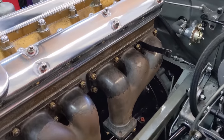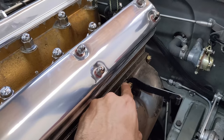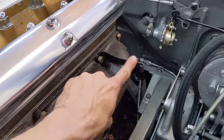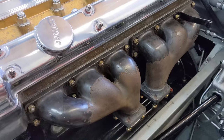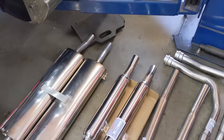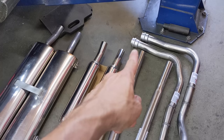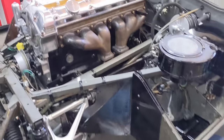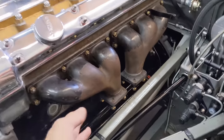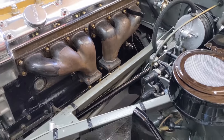Got those original exhaust manifolds installed with all the original hardware and the brass nuts, even the thick spacer washer and the dipstick bracket. I like to get my down pipes installed before I really snug these up to the cylinder head. I'm surveying my exhaust components — I have this Bell stainless steel made-in-England system that I absolutely love, but I need the flanges, so that will be in the next video. I want to move on and get the brake reservoirs on.